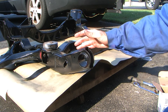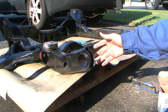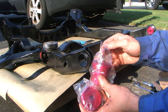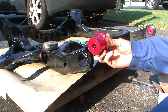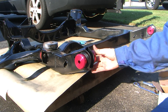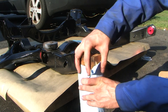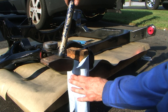For the engine cradle, if you were to use polyurethane bushings, same deal — you can see the outer lip is on the inside of the cradle so you're going to want to bang the bushings in from the inside out. In my case I'm going to be using aluminum cradle bushings. These I got from Rodney Dickman and they're two pieces. The thicker piece is going to go on the outside and the stubbier piece will go on the inside, and then you bang them in together. So we'll go ahead and do the outer side first. To maintain the nice red finish I'm going to use a piece of wood and a mallet, and I've got the piece of wood tall enough that I don't have to hold it — I can just sit it on the ground and tap it in.